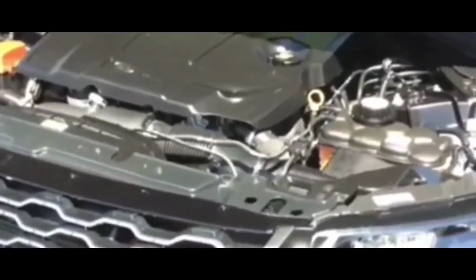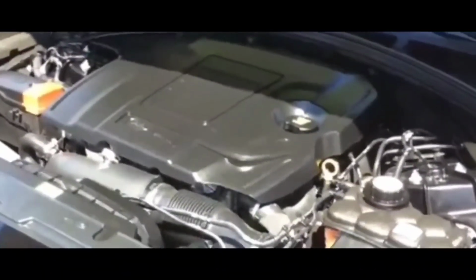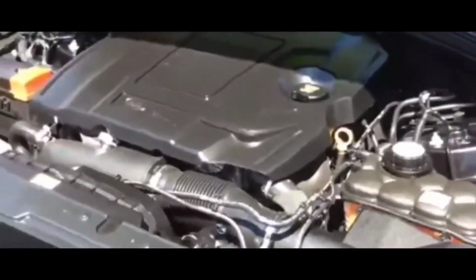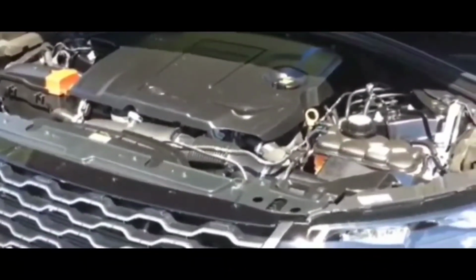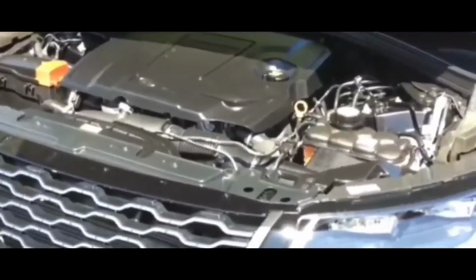So, all right, at that point, even if the booster pack was kind of low on voltage, which it wasn't, it was all the way up to 4. That's the first time I used it, and I'm like, okay, we can eliminate the battery being the problem. Not the battery. So I'm scratching my head. Definitely not the alternator at this point, because if it was the alternator, the booster pack would have jump-started the car, and then as soon as I took the booster pack off, it would have died.